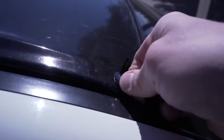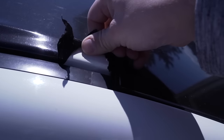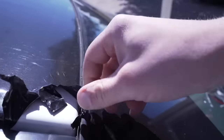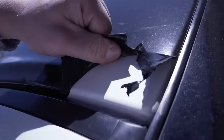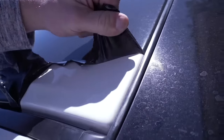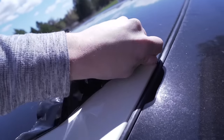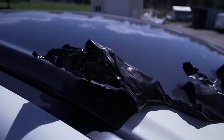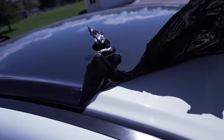As you can see, it's starting to peel off just fine. It's about 70 degrees outside and it is peeling off without any issues. If it weren't out in the sun right now, I'd be in the shop with the heat gun on this. So far it's not leaving behind any glue residue at all. The main reason you want to use heat is so the vinyl doesn't crack — and as you can see, this isn't cracking at all. I'll set the camera up and run a quick time-lapse.